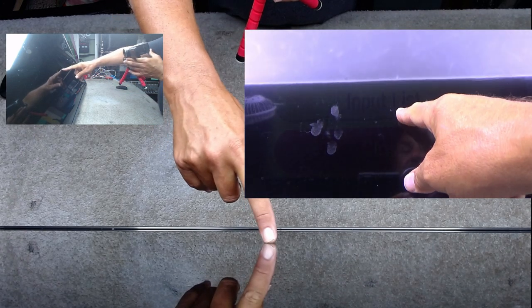As you can see, we've got a faint picture which says input list and close, which means the backlights have failed. Sometimes when you switch these on and off, which we will, you may see a faint flash of the LG logo. And there it was. I don't know if you saw that or not, so just for effect, this is how we used to know definitely it was the backlights in the old days. There we go. Used to get one little flicker.